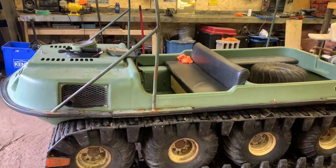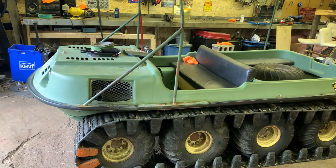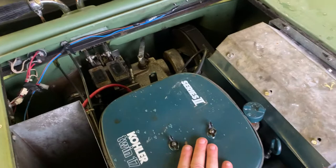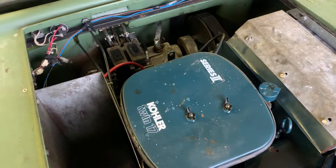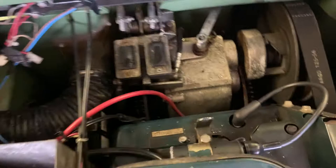So this is video one - let's test compression and see where she's sitting. I'll look up the specs online shortly. If the compression is bad, we are pulling that engine. She might get the same factory motor because it is a beautiful motor down there. So we will be testing the compression. This is the engine - a Series 2 Kohler Twin 17, an industrial variant engine. It sounds literally like a tractor, like a ride-on lawnmower type of thing. It's a twin cylinder - you can see one spark plug here and another on the back end.